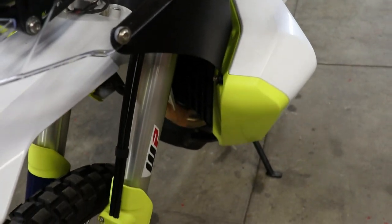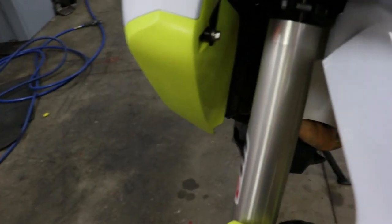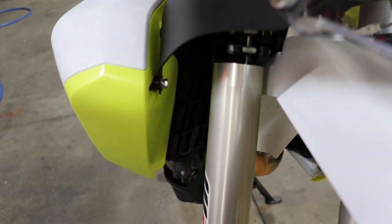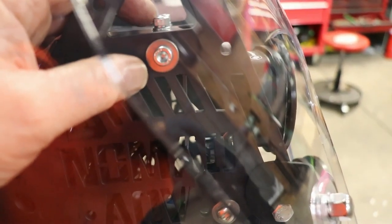The parts that we didn't find in the kit: there's a spacer in here and a longer bolt that were not provided. Likewise on the other side, so we've actually machined them up because we have machinery here in this shop. A lot of bits and pieces we've improvised. We've had to put our own nuts and bolts in. And here you'll see it's a 6mm bolt, but it's an Unbrako bolt. The cap head bolt that I've provided, because the ones they provided actually hit this bolt inside the little bit of rod in there, and therefore locked that bolt up, and you couldn't do that bolt up. So there's two little things.